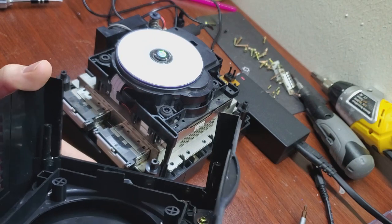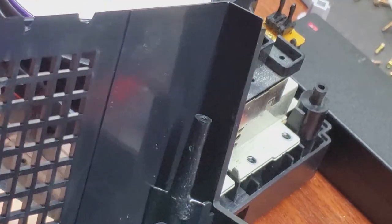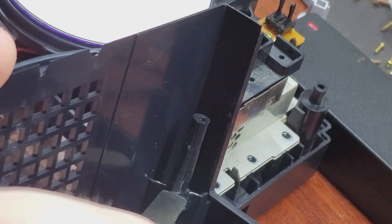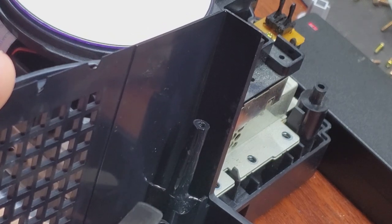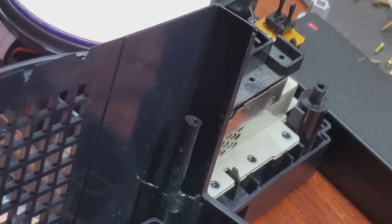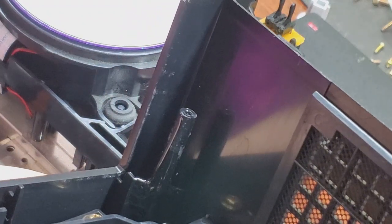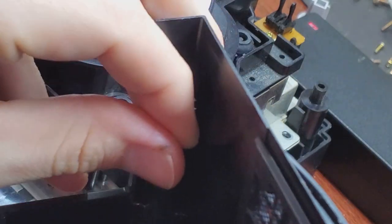Here's how I do the post repair: I use super glue and two-part epoxy. Super glue just gets things positioned correctly at first, then I coat the entire outer post with two-part epoxy on both sides. You can see the shininess and a little glob of epoxy. I want to make sure it coats both the bottom and top of the post so they work together — that's really going to offer the stability to make sure it's nice and tight.